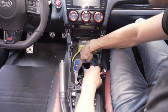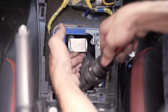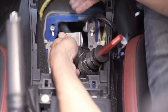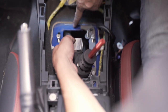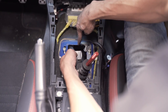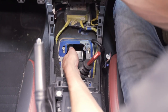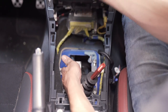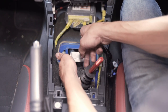Now you can really see why we cut this out. If we tried to put the shifter into its shortest throw setting — the setting closest to us — this arm would be way up here and hitting it. We basically just wanted to match the flange opening with the opening of the car. We didn't need to cut the whole thing off but that's the quickest way — you can just trim what you need, or cut the whole thing out; it won't make any difference. We just need that clearance for the shift arm.